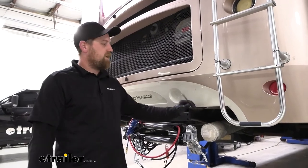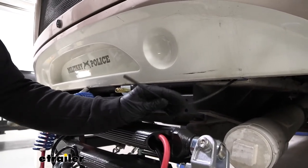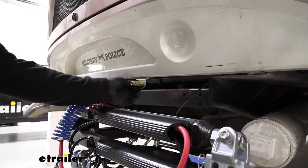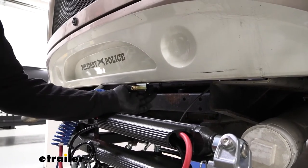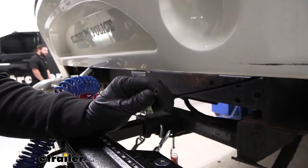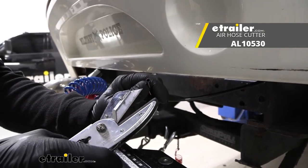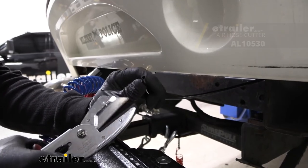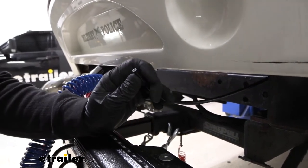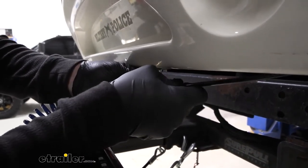At the back of our motorhome, I ran that airline from our tank. When you route this, you don't want any kinks in it or to run it next to hot or moving parts. That's going to get connected to this fitting here. I just drilled a couple of holes and bolted it in place where we can get to it. The fittings are quick connects. When you cut these lines, you don't want to use a regular pair of snips — use something like a razor edge or a tubing cutting tool. Make sure the cut is clean and straight so we don't develop any leaks. With these quick connect fittings, you simply just push them right into place.